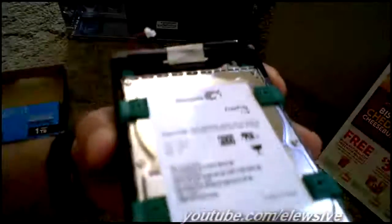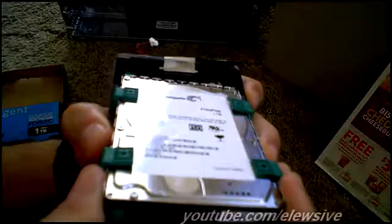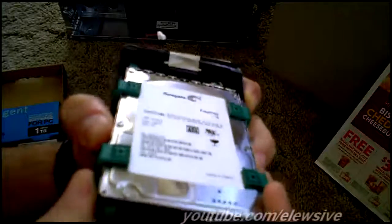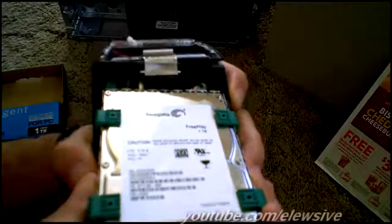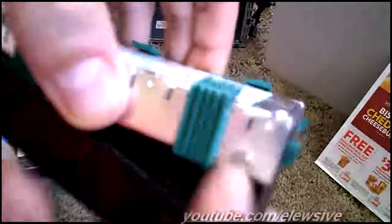To get this drive nudged out — it's nicely wedged in pretty good — it has these little rubber grommets that also have adhesive. The trick is you don't really need to get all these grommets out, because the drive is encased in a little shell that can be unscrewed. What you'll be doing is prying alongside here until you get each of these flaps out and open, then unscrewing all four screws.